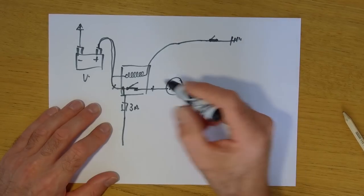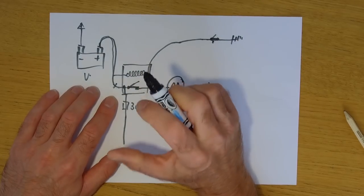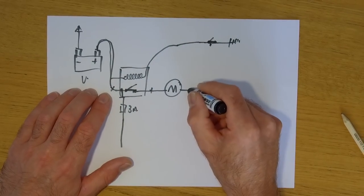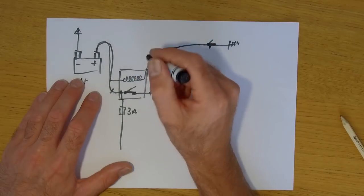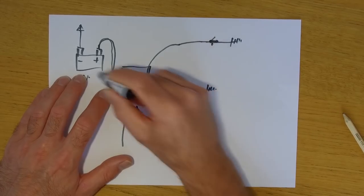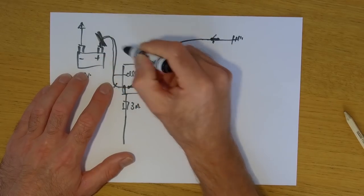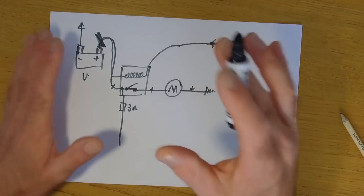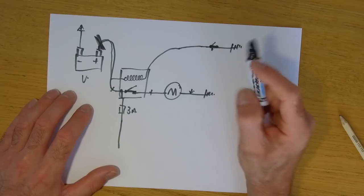And then what can sometimes happen is you push the button, you energize this solenoid, and you get just one click. I think I mentioned that previously. Normally that's indicative of either a bad earth to the starter motor or a bad connection maybe on the battery terminal, because when you energize, you get that click, the relay clicking shut, it draws a load of current, and if there's big resistance somewhere, the connection is broken completely. So you get one click and then everything goes off. That's a separate thing to a flat battery, so I'm not explaining this that well, but don't get confused with that. Anyway, we're going to go to the bike now and do the actual repairing.